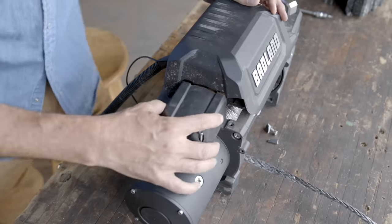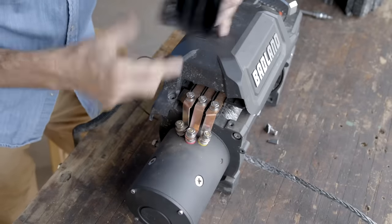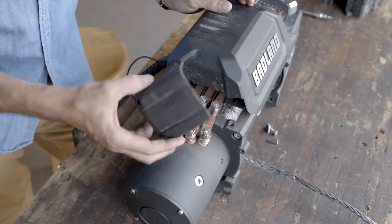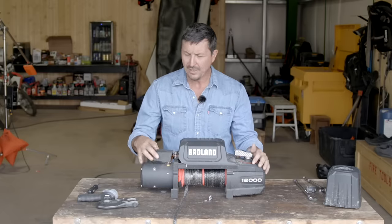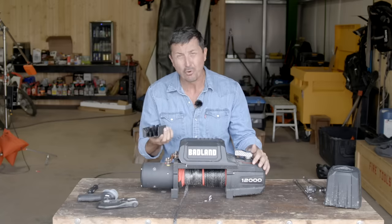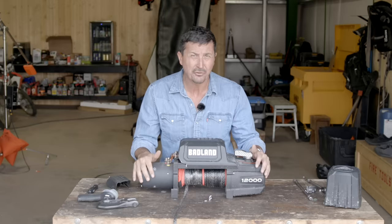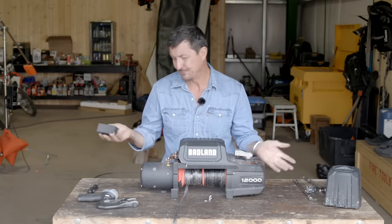Because these contacts were so tight, when the whole thing shifted and rotated, this plastic came into contact with what was exceedingly hot and started melting. It wouldn't take much more for this to start on fire, and that's tucked up underneath a brand new truck. What seemed like a great value at a third the price of a 12,000 pound Warn isn't such a great value if this thing were to catch on fire. This didn't catch on fire, and I don't know if it would have, but when I have plastic that's melting and smoking the possibility is there. We're going to save a few bucks by putting this on the front of a $90,000 truck — maybe not the best idea.